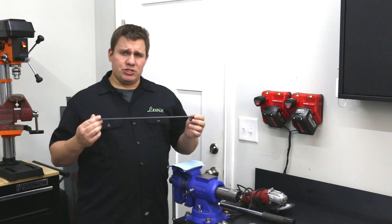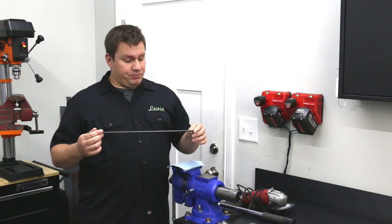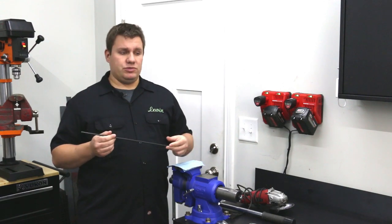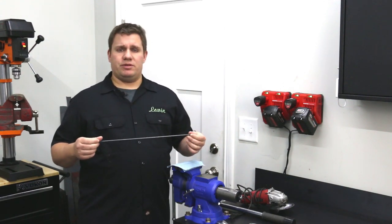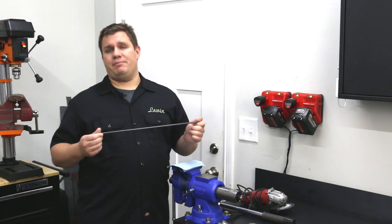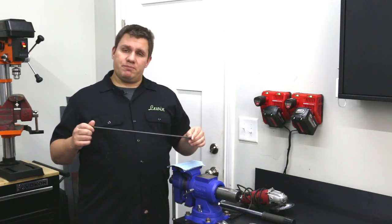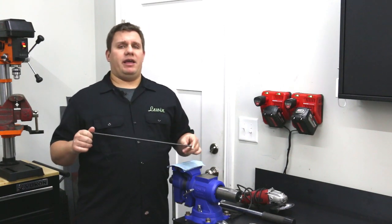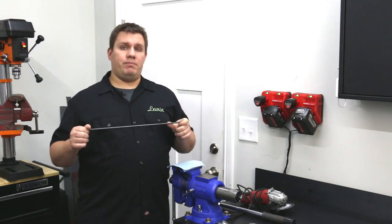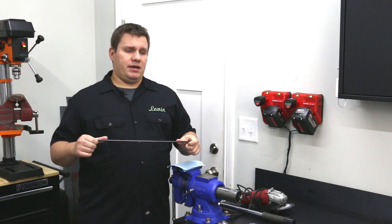A splitter support does one main job: hold the splitter up against the downforce that is created. That's a pretty easy job — you could do it with turnbuckles, which a lot of people use, or cables. We saw a couple of problems with those traditional options. With a turnbuckle, those are rigid supports, which is good generally until you smack them on the ground. The turnbuckle is really strong, it won't bend or deflect, so what happens is the actual mounting locations or bolts going through the splitter deflect instead, and it can ruin your splitter.